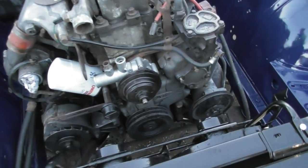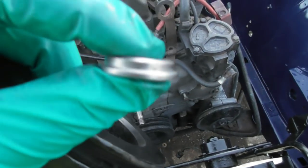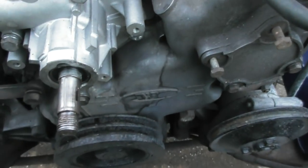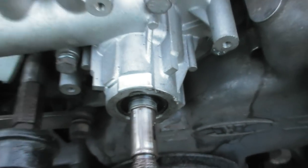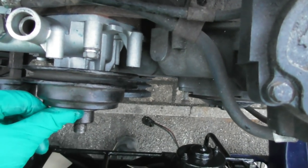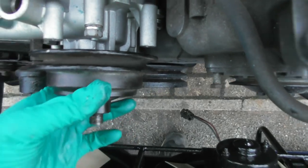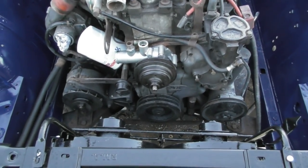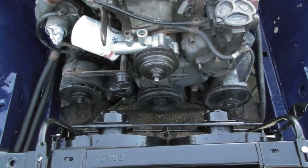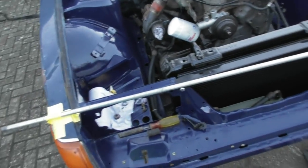It's going in circles with this water pump. When I got it, it had a spacer machined onto it that covered a split ring holding the bearing in. But if you have that spacer in when you fit the water pump pulley, it doesn't align with anything. If you take it out, it actually aligns with the rear groove on the crank pulley, which I think is where it should be. I need to do some research and review some earlier photographs, so I'm going to leave the water pump for now and go find my headlights.